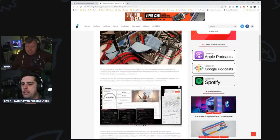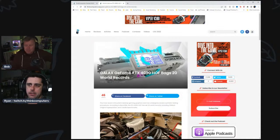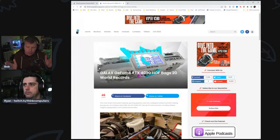That card is insane. It's crazy looking though, so over the top compared to the normal layout. It's got a screen on it, all sorts of extra plastic, and it's the one that has the dual 16 pins. Oh my gosh, you want to make sure those are in there correctly, all the way in. But actually, having two, you wouldn't necessarily. I mean, this is for overclocking, but if you're just a normal user, it balances out the load, so you may be a little safer.